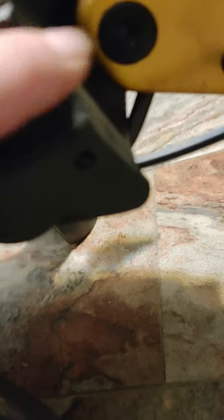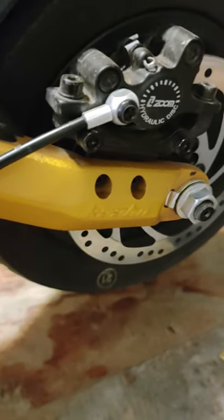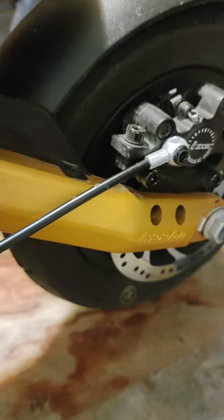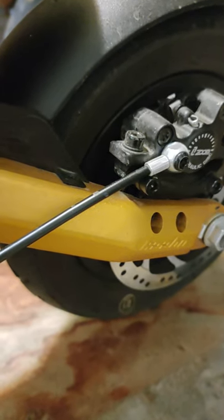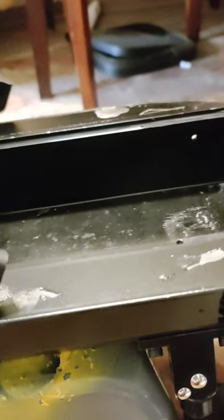When you put this on, this side has a hole where the wire for the motor and the cable for the brake caliper come in — I will silicone that shut just to make sure no water gets in there. The wire going into the motor needs some silicone around it. I recommend pulling up the little spring things they put on here to keep from wearing wires out, and then just don't pump it full of silicone, but definitely fill it up enough so no water can get into your motors. I've split the motors apart, so I trust they're pretty sealed up, but they're not river proof — you can't soak them, but you definitely can splash them.